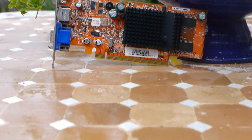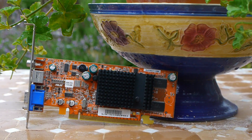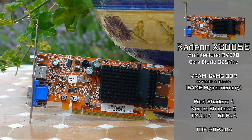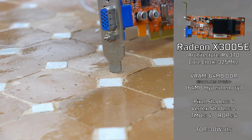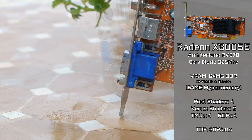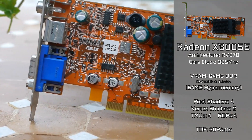This right here is the ATI Radeon X300 SE. Not that it's really much of a difference from the standard variants, although by default this variant can take advantage of your system RAM better than the other versions can. Based on the RV370 architecture, it was released in late 2004 with 4 pixel shaders and a core clock of 325MHz, along with 64MB of DDR RAM clocked at 200MHz.